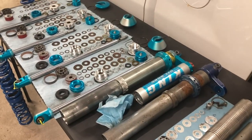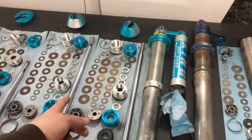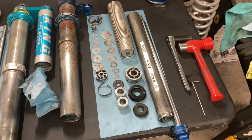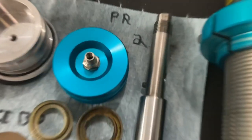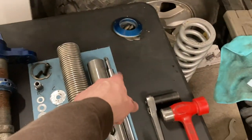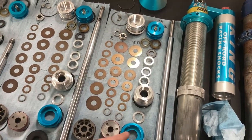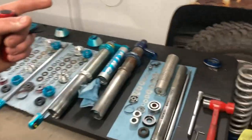Back to shocks - I think I covered everything I mainly wanted to cover as far as differences between the King internal bypass and the Fox internal bypass, and what the components look like inside. The King has that inside-machined doohickey shaft, while the Fox just has a regular shaft but way more valving stacks and setup. For me, both shocks are great - I'm not a person who says don't buy this or that. But if you ask me what to put on your truck, I'm going to pick the Fox internal bypass every time.